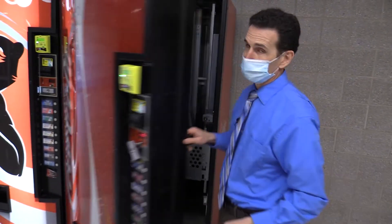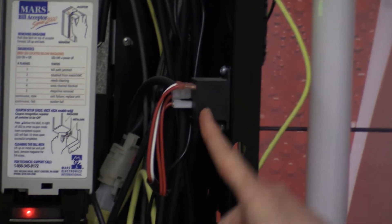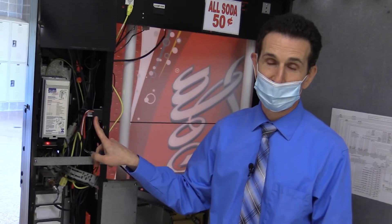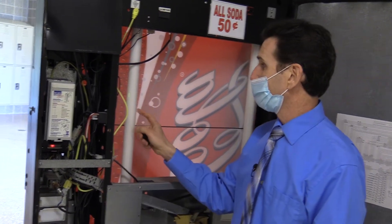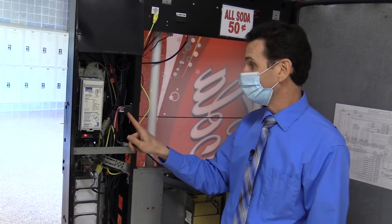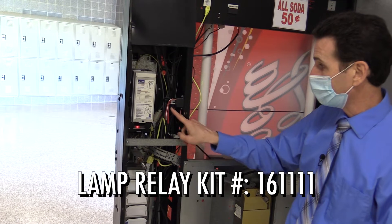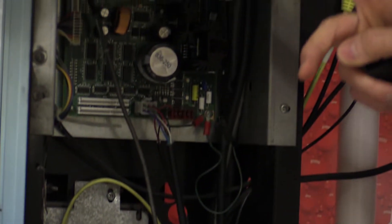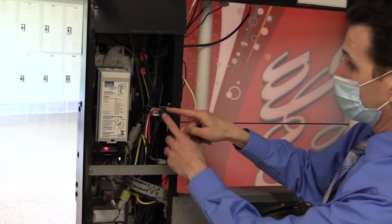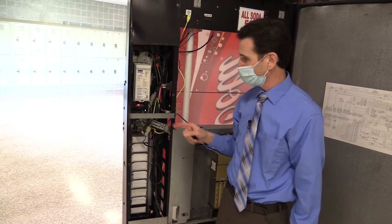In this Royal G3 machine, I actually added a relay. If you take a look up here, this was an add-on relay so that I could have the control board control the lights in the machine to help the school where this machine is located save some electricity at night. When nobody's in the building, the lights would turn off. It also helps the bulbs last a little longer. This machine didn't have the light relay in it — many of the G3s didn't ship with it. It was an add-on kit, so I bought the kit. They gave you the relay and the jumper cables that go to the control board as well as down to where the lights get the voltage. I mounted the relay here because you had to pick a spot midway between the two.